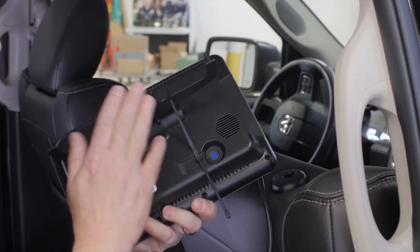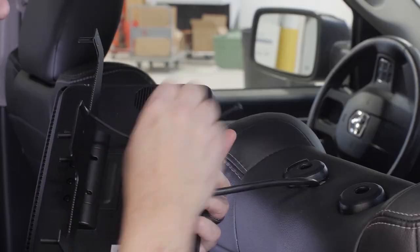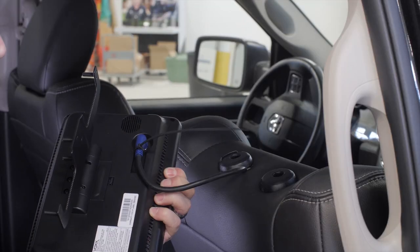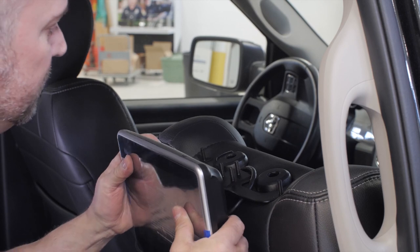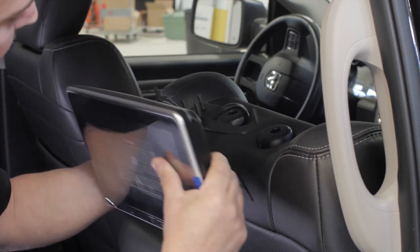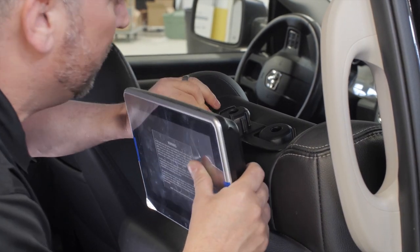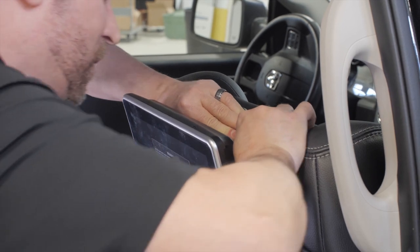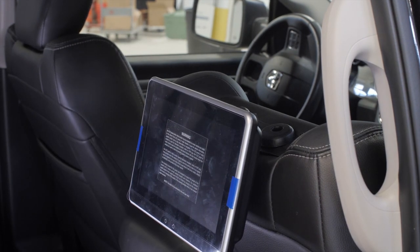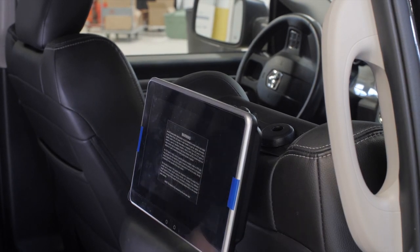As you can see here, I've got the bracket now mounted up to the monitor. I put a wire tie in there so once I plug in this cable I can keep it nice and safe by locking it in. Once that's done, you're going to mount this to the seat back. I'm going to take this wire and bury it underneath. There's a little lift in the actual bracket to accommodate some spacing. You might have to tuck your cable back into the seat a little bit, but this is going to go underneath the seat post guides. It slides in relatively simple, and the first part of the mounting bracket is already attached — and as you can see, the system is already pretty sturdy.